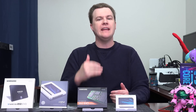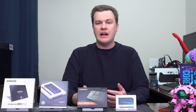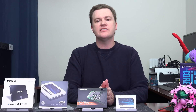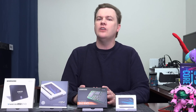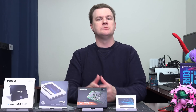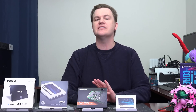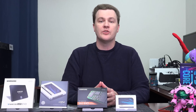I have several drives with over 100 terabytes written, but they're like four and five years old, heavily used as boot drives with Windows updates, games, and programs installed. I have not seen drives in normal use — even in business eight-hour, five-day-a-week use — come even close to 50% of their drive life in four to five years of service. I understand it's a common concern: there's a limited amount of writes on these drives — what if I wear them out? You're not going to, unless you deliberately try to destroy the drive. In server or certain database and multi-user workloads it's possible, but for 99.9% of anybody watching this, that is not remotely a concern. The drive will be completely obsolete, and it will be 10-plus years before you come close to the endurance rating.